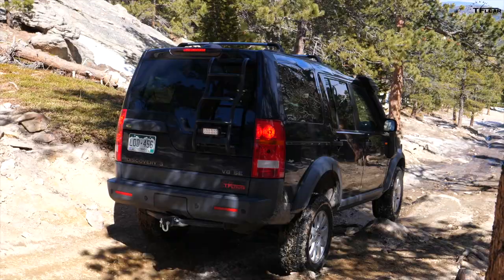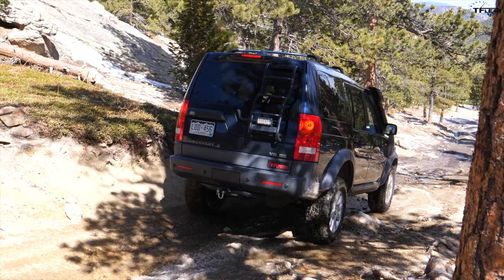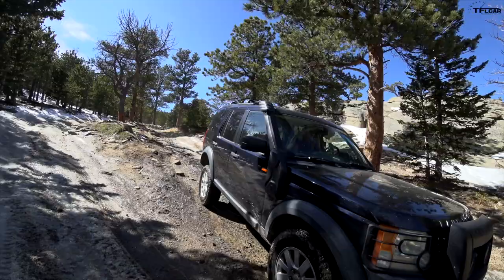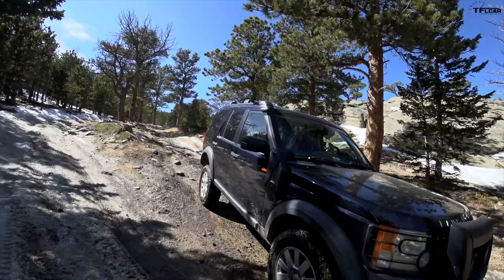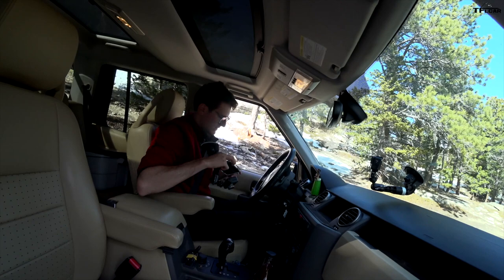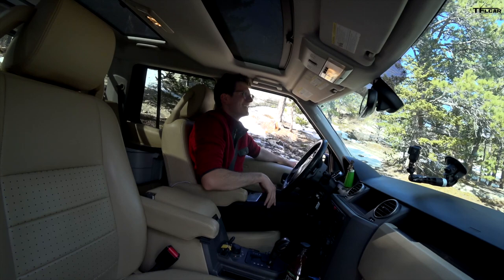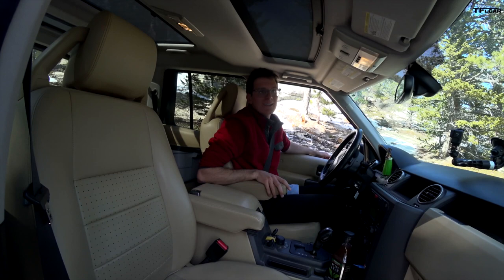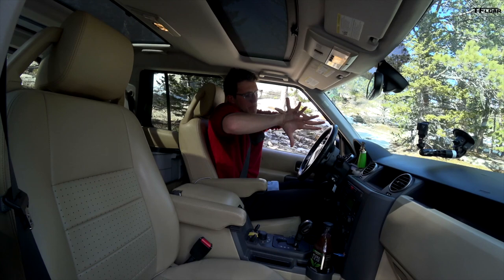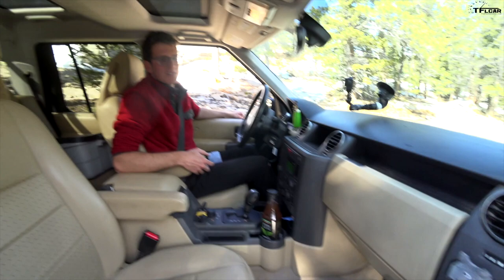Both vehicles have four-wheel independent suspension, which would normally be a problem for off-road articulation, but Land Rover uses a cross-linked air suspension system — essentially a tube connecting various ends of the vehicle so that when one wheel articulates the other is pushed down, emulating a solid axle. It's not quite as good as a solid axle but works very well. The LR3's Terrain Response works well but is slower than the Range Rover's instantaneous system — it takes a little more time to think, but once it does you can go just about anywhere.